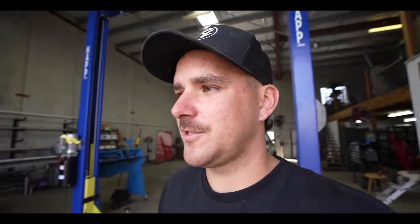Right now the car's getting a little bit of a look over. One thing we've noticed is that the motor is really knocky at the moment. We're thinking it's the plus 30 injectors, or it could also be that we don't have the MAF plugged in. What we're going to do is chuck on the little pod filter that Matt's made up with the 3 inch MAF in it so we can actually plug the MAF back in, and see if it sounds a bit better. Got to put water in the radiator as well because there's no water in it.